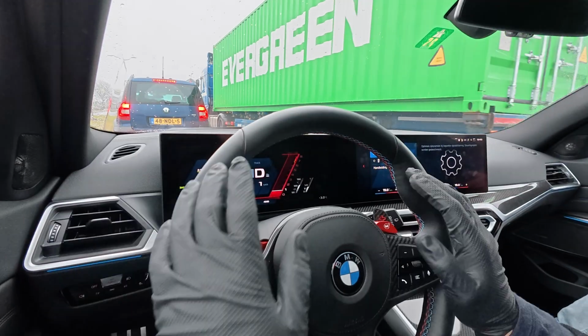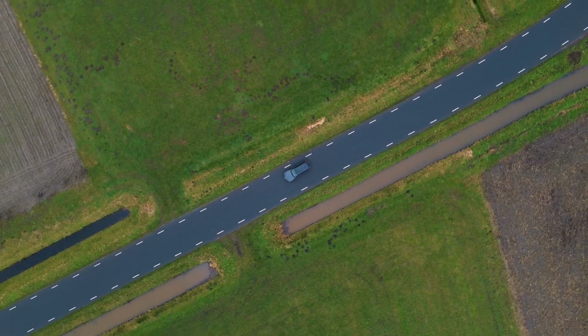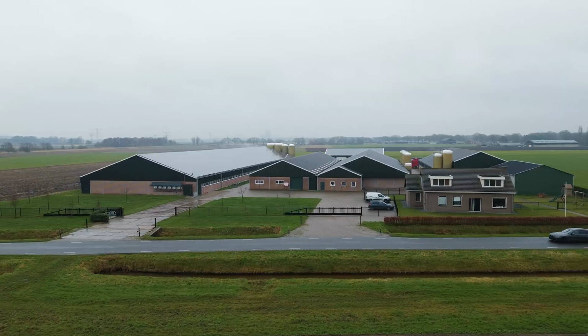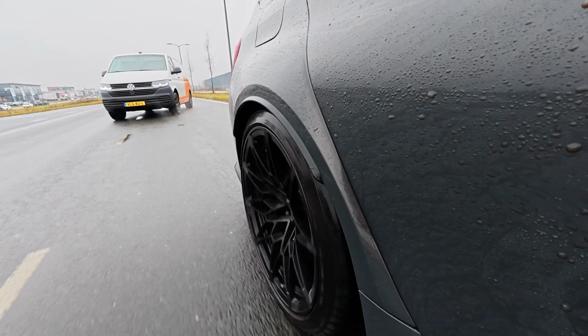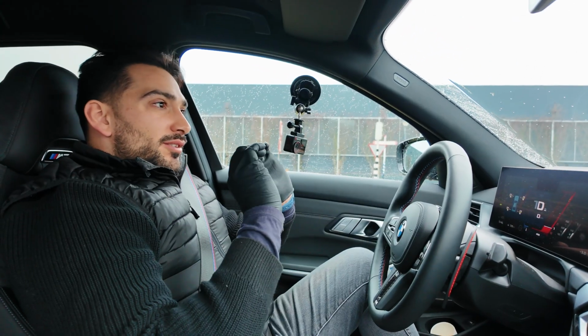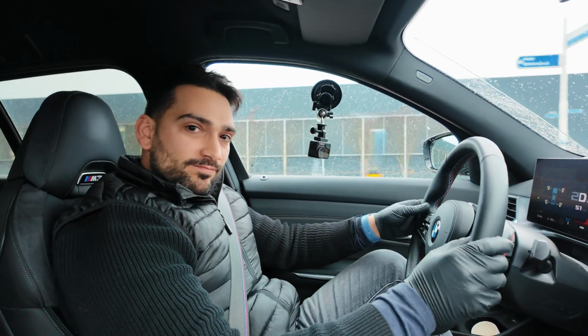You don't need that much torque when you're driving, for example, on the track, but the power is, of course, nice. For the power figures themselves, this car has stock catalytic converters in place, so it is not a stage 2 setup, and this is what I would like to call a stage 1.5, with only the OPFs removed from the car as a hardware solution. And other than that, it's just fueling. It just uses fuel, 98 octane. Really, really respectable power figures for something.